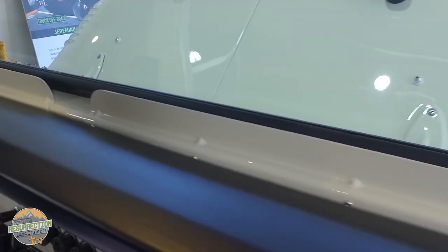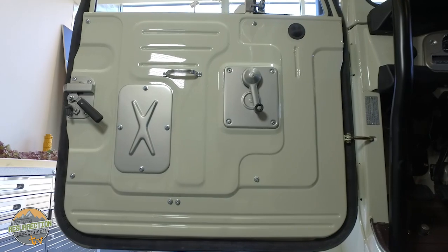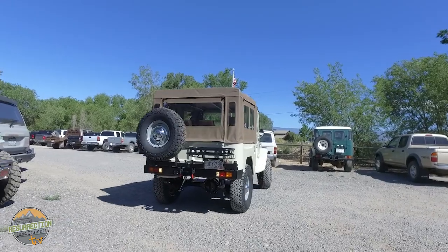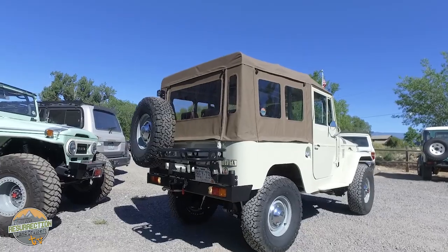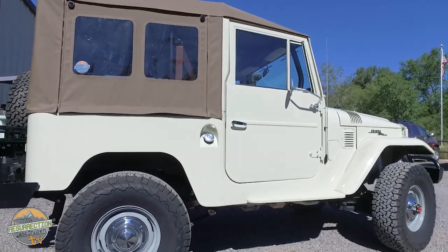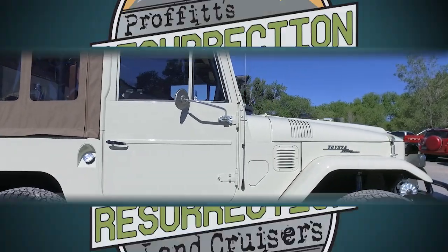All of our FJ40 solid color and FJ60 solid color restorations are painted with a single stage paint so that they can patina correctly from the moment they leave the shop on. Like we do with so many of our FJ40 restorations, we've relocated the rear wheel wells back about 3.5 inches and extended the wheelbase just by flipping the rear springs around and moving the shock mounts, because that extra 3.5 inches provides a lot more drivability and also better off-road ability.